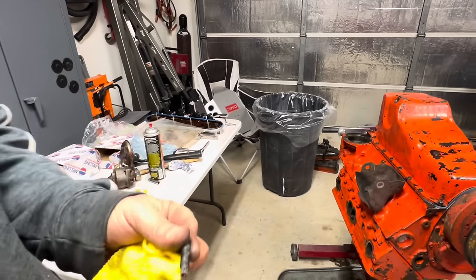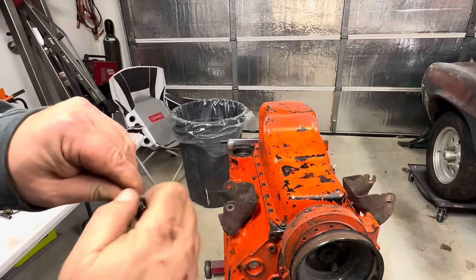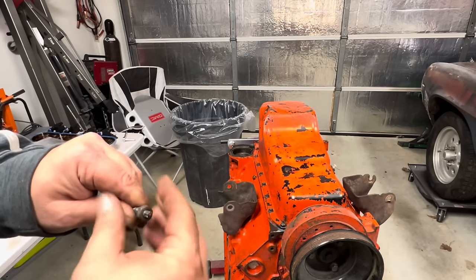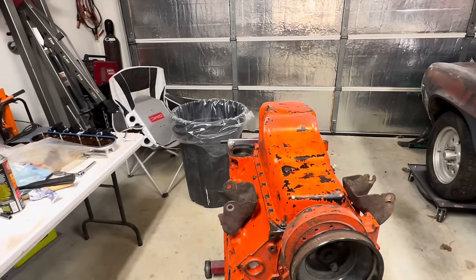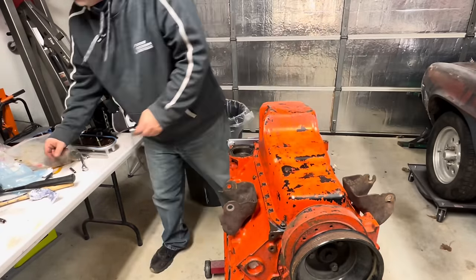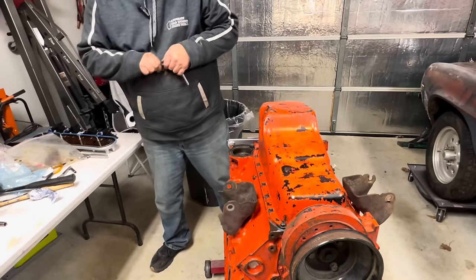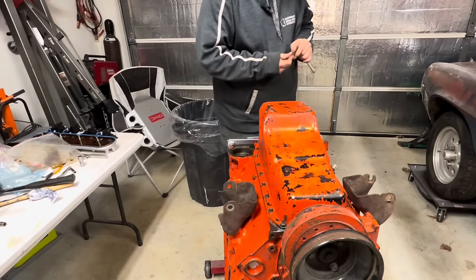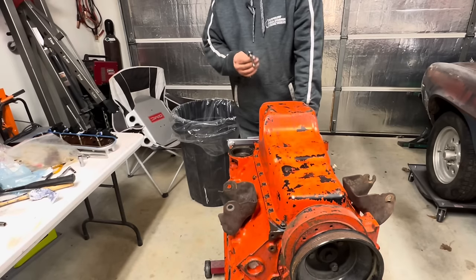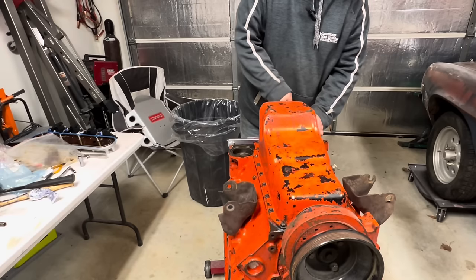Let me put it on the wire wheel. Now, see if our nut will run all the way down. Okay, it will. So we'll try it again here, see if it'll tighten the pan up. Nope. Could be that it's the wrong stud, because it's not allowing the nut to go down and seat the pan the whole way. Of course, if you remember, when we took this off, nothing was seated or sealed. It was on here just loosey-goosey.